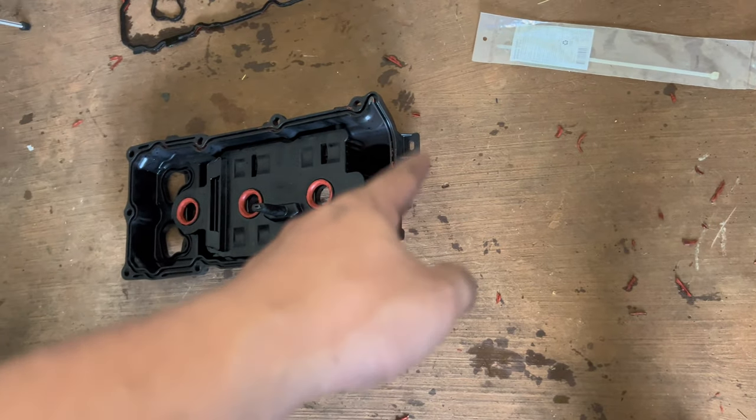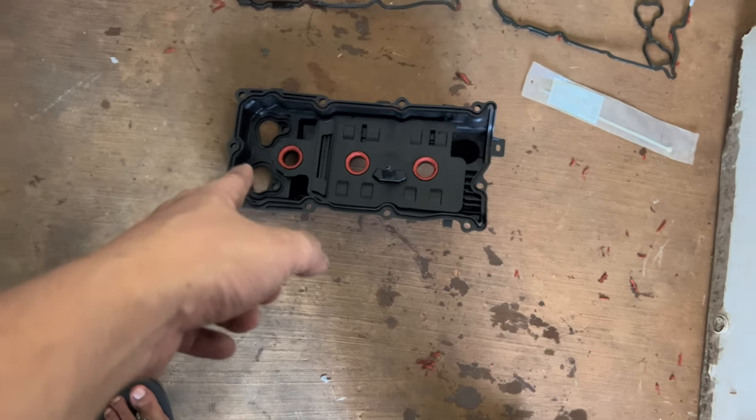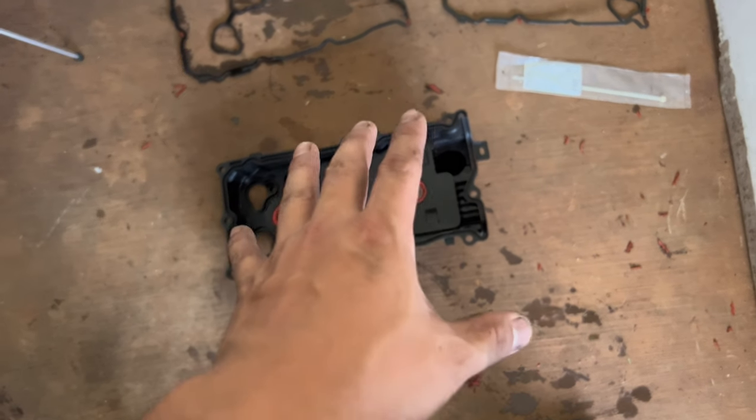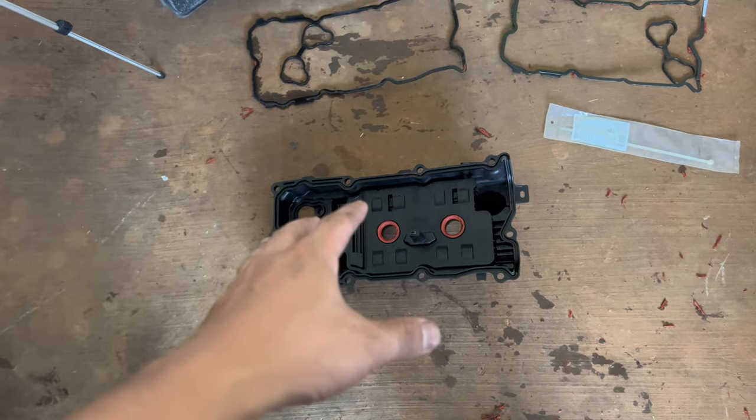We got all our connectors and stuff that we got loose and the brackets on. These are going to be for the air filter box and the intake hose — it should be two like this. Don't forget to put this hose in and then tighten your negative terminals to the chassis. Now we're going to input the two air boxes. Now for the hard part — it's also the first thing that was the hard part: putting back the intake manifold. We're going to put that in. Be careful in the rear end and just plug in all those holes, connectors, and put the intake hose on last.